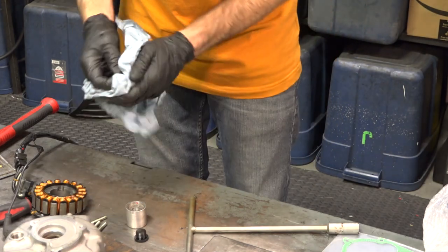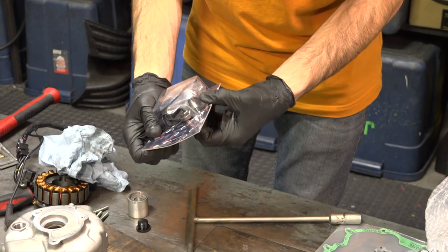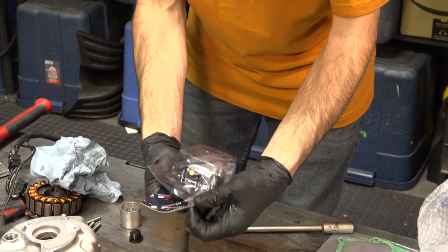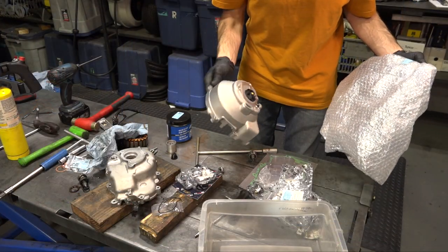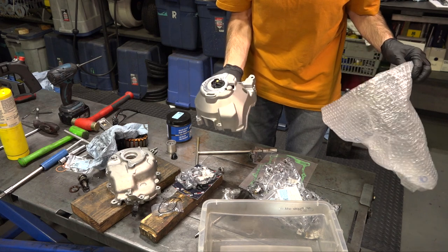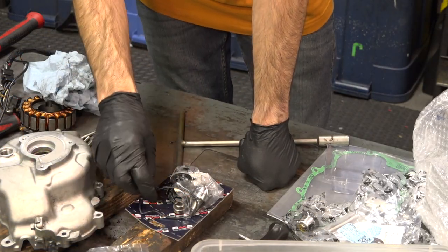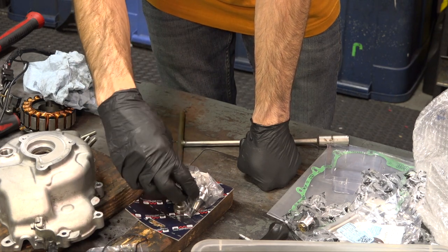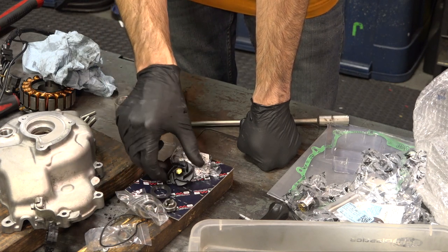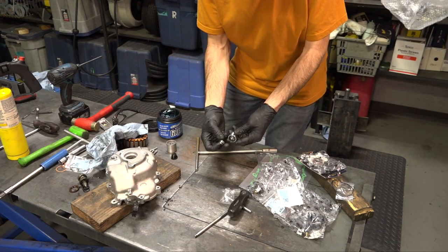There's another way with a nice high-quality kit — part number 842565-KIT. The nice thing is it includes a brand new shaft with the water pump already on it. Note this specifically shown is for a GT200; there are several different variations for the 250 and 300 motor. Make sure you call with your VIN number if you want to order a complete replacement water pump cover. In the kit you get another one of those spring drives, the water pump O-ring, a brand new shaft with bearings, the oil seal, the water pump impeller, and the water pump seal itself.